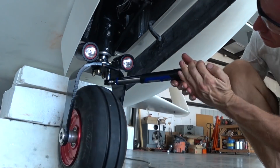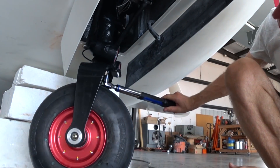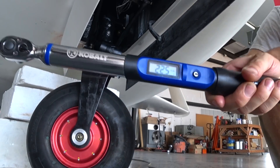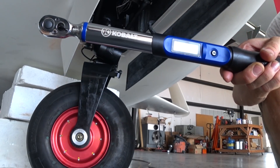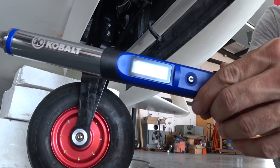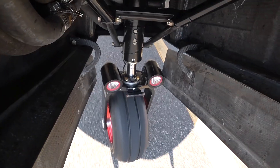Here back on the torque wrench again, just to do a bit of a test. Last time I ran it I got around about 10 on a normal pull and managed to get 20 on a really quick pull, but this one here on a normal pull I'm getting 22, so it's definitely more viscous. Hopefully that'll be the solution.